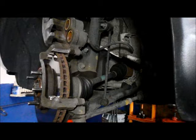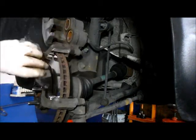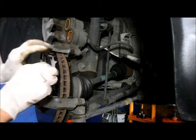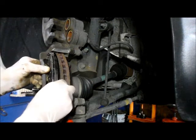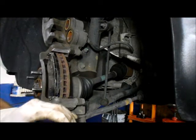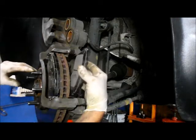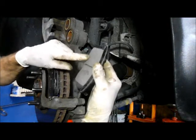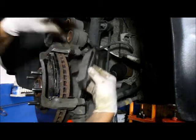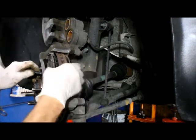Whenever you replace brake pads, most of the time they give you a little lube to put on here to make everything slide. You put it on the contact points. The easiest way I find is instead of pushing the pad in perfectly flat, just put it in at a little bit of an angle and it just pushes right in. Same thing on the back brake pad — put some grease right here and right there. Then take the brake pad and put it back in the way you took it out. Make sure you watch how you take it out because it's only going one way. Put it back in with a slight angle and you'll feel it lock right in to where it belongs.